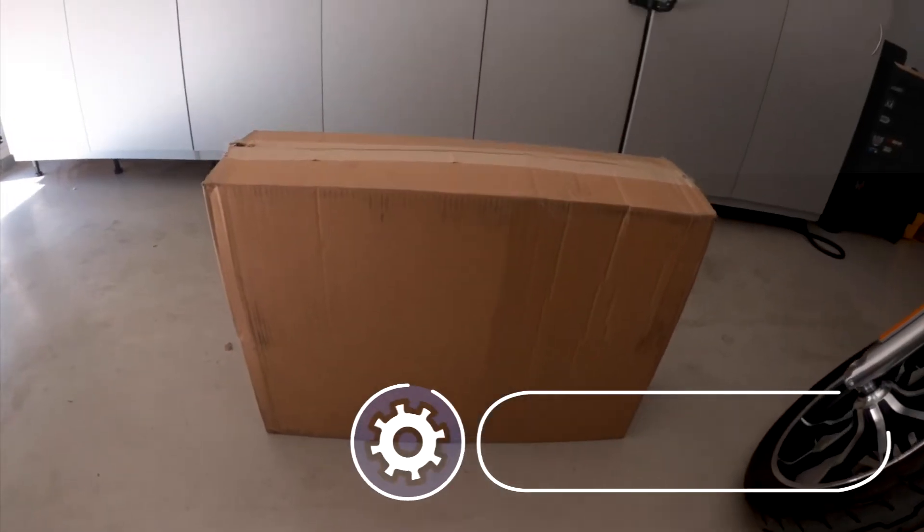From my past experience installing the other engine guard, I found that loosely inserting the bottom bolts to hold it in place while you work on that top center bolt is probably the best way to go. These ends here will face towards the bike, and just make sure the carved-out pieces line up with the frame. I also put a shop towel on my fender just so I don't accidentally bang it up while trying to get this bar in place.